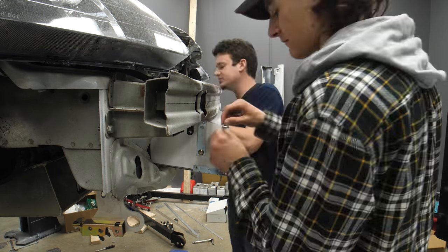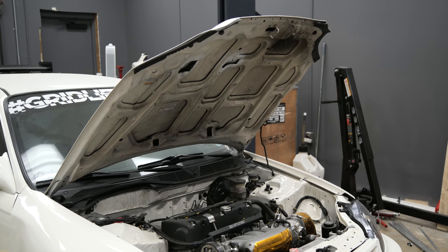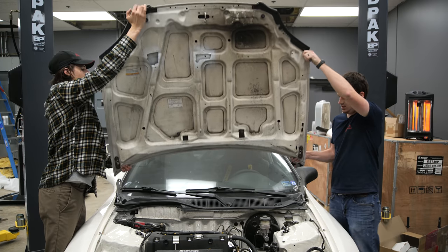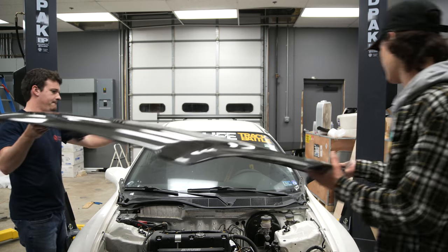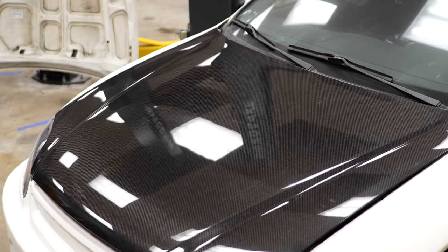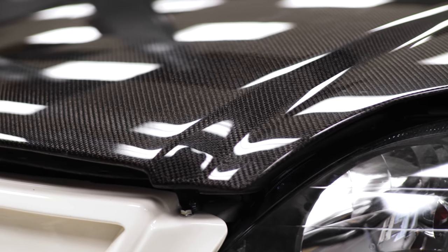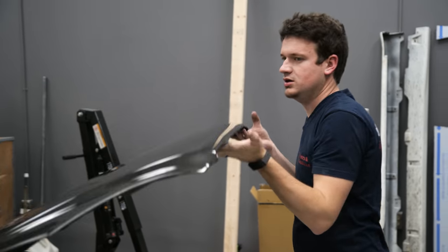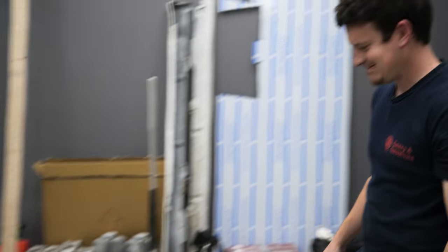With the ducting complete, all of my aero is almost done on this car. It's time to get rid of my OEM 97-spec Type R hood — it doesn't fit my 99-spec front bumper, and it's made of metal. We're trying to keep our center of gravity low, so let's replace it with a carbon fiber hood. Carbon fiber is brittle, and unfortunately the company I ordered this from didn't package it right, so it arrived cracked. But this hood is 9 pounds lighter, which means I get to put more ballast weight in the car at a lower and more centered position.